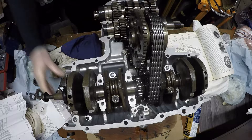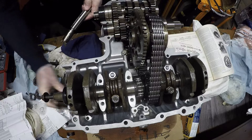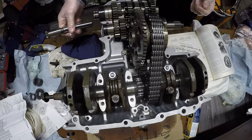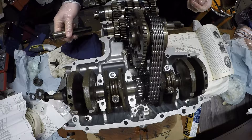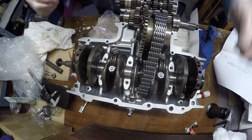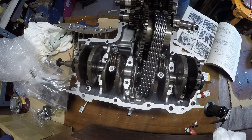I learned the hard way after trying a couple of times over a couple of evenings. I couldn't do it, so I had to split the crankcase again and made sure the primary drive chain was sat correctly on those teeth on the crankshaft. If you ever get to do this - it looks so close when you look through but it isn't. It's like a millimeter out and you think it just needs a wiggle, but it doesn't work.